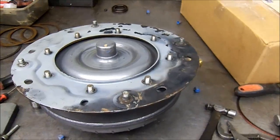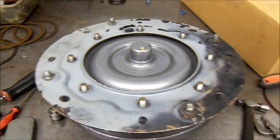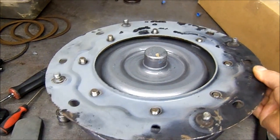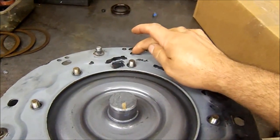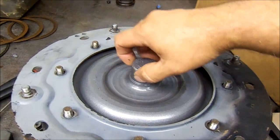This is the 5R55 — it's a V8. I've got the unit here already almost ready, finished. On the V8 you have an 8-lug converter, and you have your brand new torque converter. This plate here needs to be aligned — you have two alignment slots, one here and one here, and you want to take all the paint off of this hub right here.